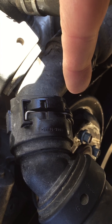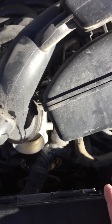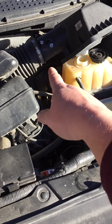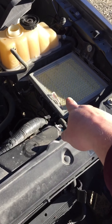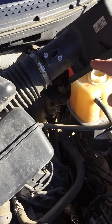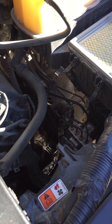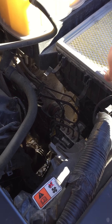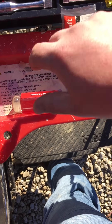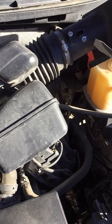If you got a specialty-made O-ring it'd probably be a little cheaper, but five bucks. What you want to do is find out where it's leaking from — sometimes guys are having issues with that connection right there coming off the reservoir tank, so make sure it's not coming from there. That hose runs around and goes into there where the thermostat is, and that's the start of the Y-pipe.